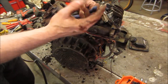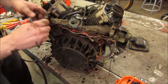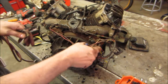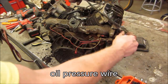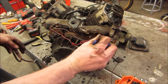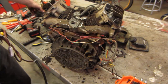Yeah, you get that intake manifold off, so let's cut our way through some of the tie wraps. Go see where that one went, because that's our, it could have been unplugged on the other end. Hey, it won't run, it keeps shutting down. You pull the wire off, it stays running for a while.